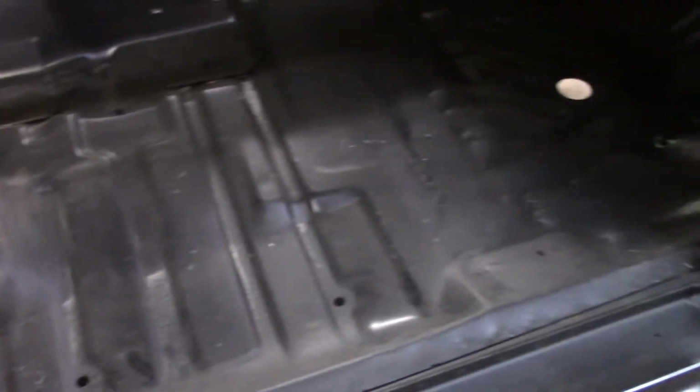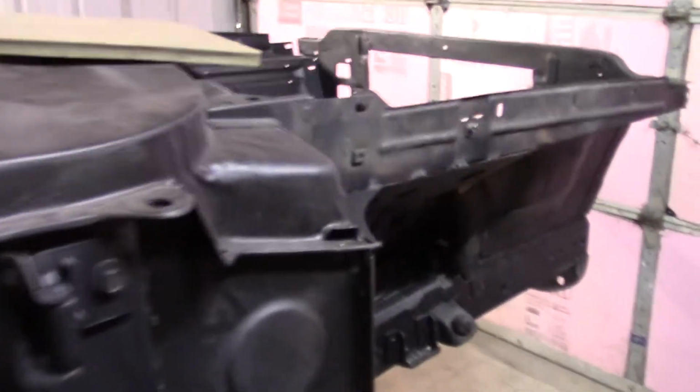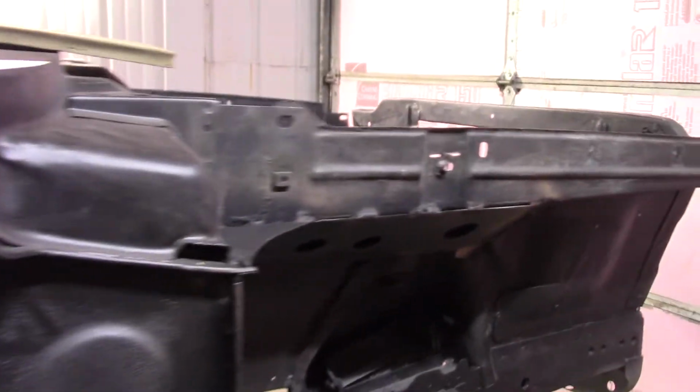We'll probably end up doing the doors as well. The floors are all welded. The ground welds are all dressed, and we got it in the black epoxy primer inside. So we're getting there. In the front of the chassis, my repairs are made.